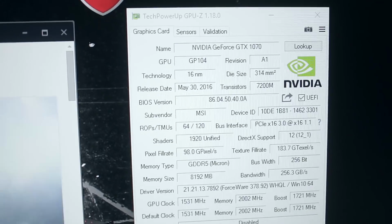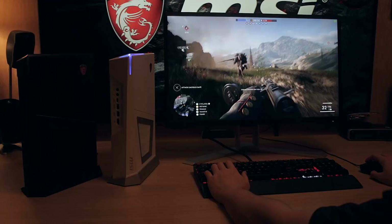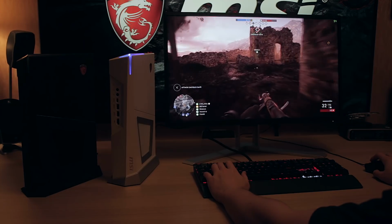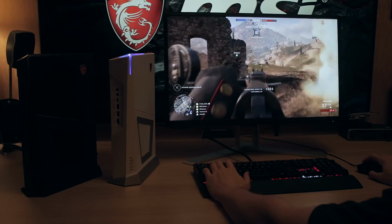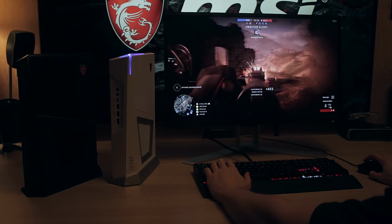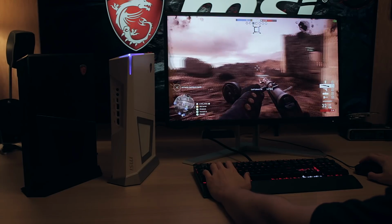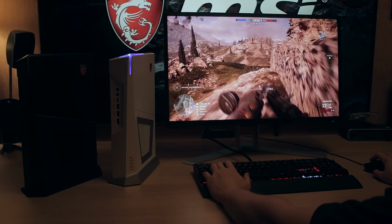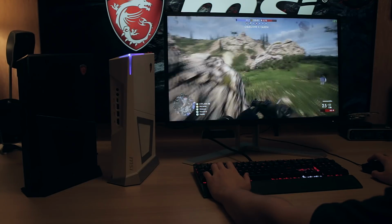Now that is a very concerning issue, as this is a critical point for a CPU or the parts on the motherboard surrounding it. I didn't find a way to manually adjust the fan speed settings in the BIOS or via an MSI app for the CPU. In short, I felt that the cooler was way too quiet while gaming, almost making no noise at all. But I would definitely be willing to sacrifice this if I would get about 30 degrees Celsius less heat on the CPU, which in return would mean about the same amount less heat for all the surrounding components.